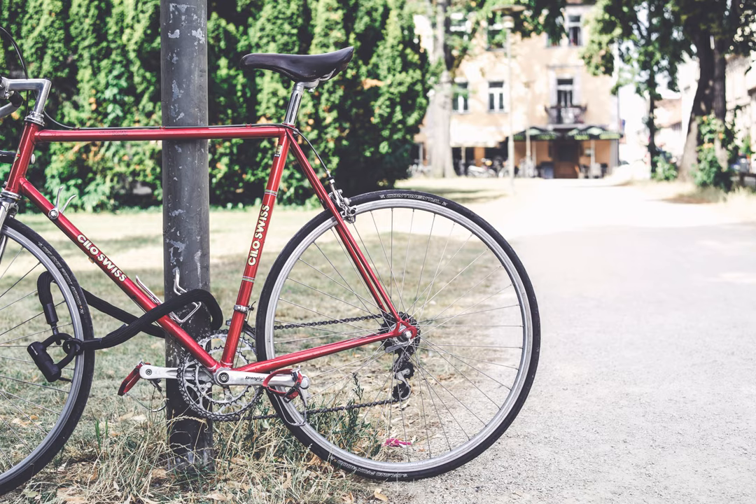The front brakes have been a bit noisy and bumpy under medium braking, and the pads look thinner at the side closer to the rear of the bicycle. It looks like there's wear on the outer of the rotor arms — I guess this is related to pad wear. I'll swap the left and right pads over until I get a new set; hopefully that will put a bit more pad where it's needed.